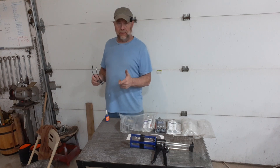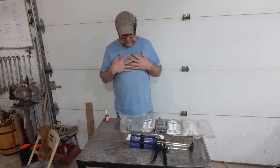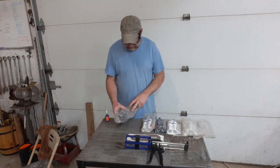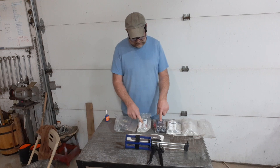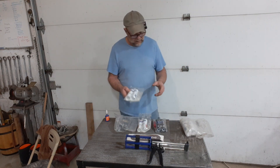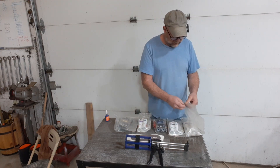So the next step would be seam seal — that's pretty good stuff, there are a couple of different kinds out there. Normal seam seal in a normal caulk gun is not my choice; it doesn't last as long. Then you can go to a multi-purpose panel bond, a two-part that uses this fancy gun that costs more than it should for a caulk gun. 3M makes a good panel bond that would last a long time. Then there's heavy-bodied seam sealer. If anything, you would go with a self-leveling seam sealer, which is what I've got here. It's designed almost for this exact thing — you put it down and you want it to settle in the low spots and level itself off. So that's what we're going to use today.